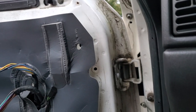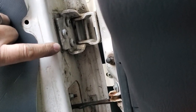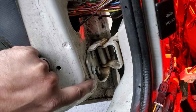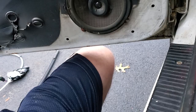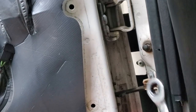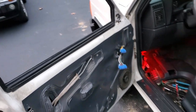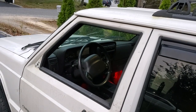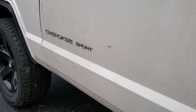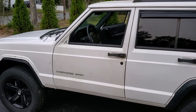I kind of rushed this part, sorry — it's getting dark. There is the hinge. If you get these shims lined up with your old paint lines — it's kind of hard to see in there — you just want to make sure that outline of the paint is right where it used to be. Get your old shim lined up with the new door and everything should be pretty close. I wrestled this door where it needed to be using my knee, lifting up on here, then tightened these down one by one with my modified tool. The door is on, very well lubed with anti-seize — not too bad at all!